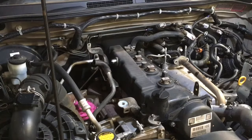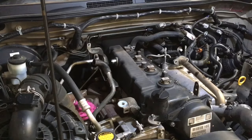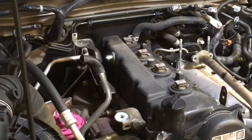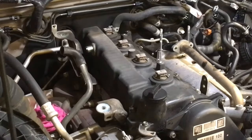That's what I'll do with that, pull that off, just twist it around. No need to take it off, or then you know where it is, where it's going to be. Now all we've got is the 10 bolts and 2 nuts. So what we'll do, let's set up the impact driver and the uni joint. Let's try and hit them all with the impact driver and get them all off. Try and get them off a bit quicker and see if it works out. Might not work out, but we'll give it a try.